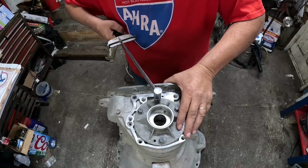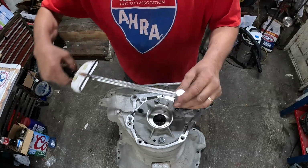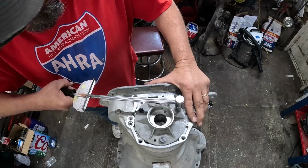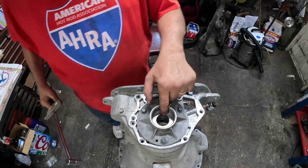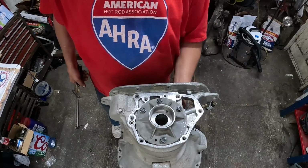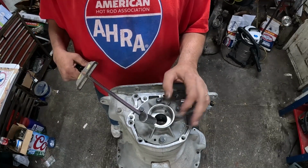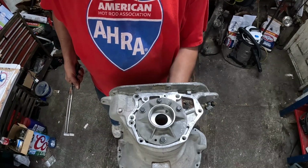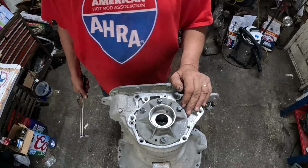Yeah, I tell you what, you really want to keep an eye on your torque values on this stuff, because you're putting a steel bolt into aluminum, and steel usually always wins. We did kind of scuff this bore with a little bit of Scotch-Brite. So, next we're going to go on to, I believe, our sprag, the rollers and springs, the reaction clutch, or whatever you want to call it. So we'll go ahead and get set up for that, and that'll be next.